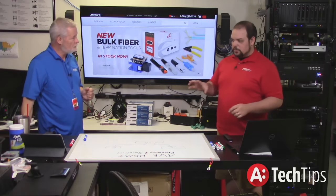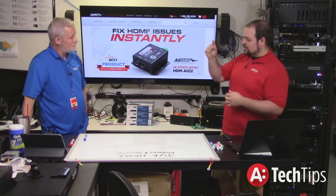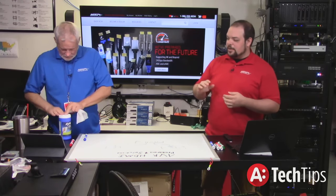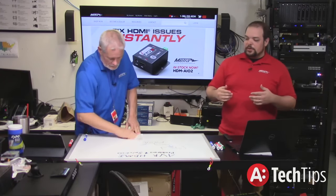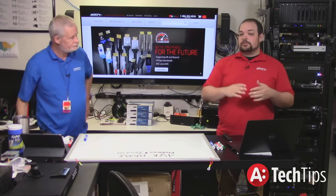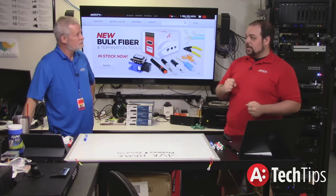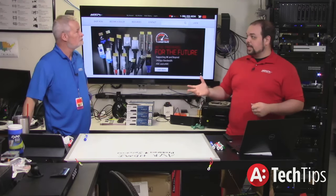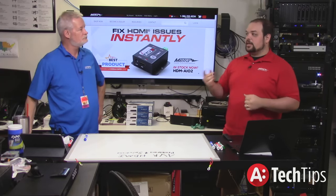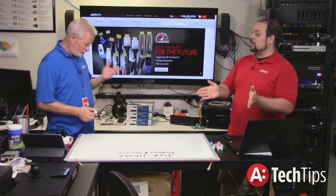Let's talk about the actual programming inside a control system. For my approach, whenever I turn on the room or the TV I'm watching, I open that relay, then close it at the end. When I'm turning off that TV, I do an open relay so that every time I switch to a different source, it always opens and closes — and if for some reason that relay isn't open when going to watch, I still send that open command just in case.